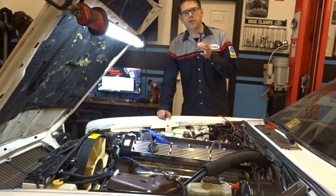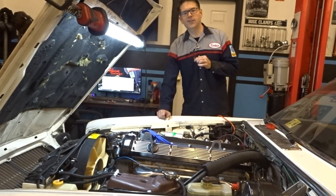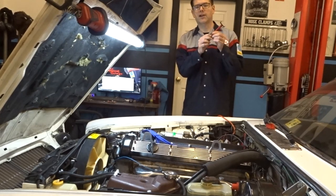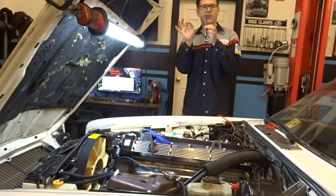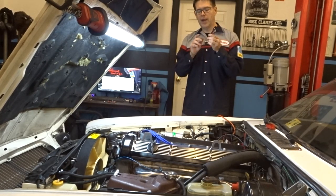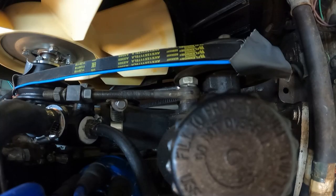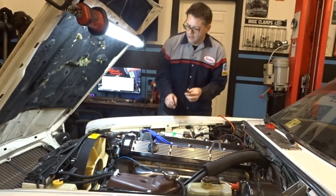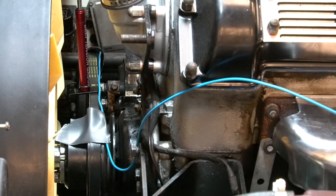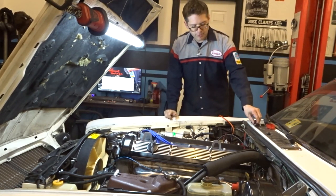Next up we're going to do the belt to the power steering pump. According to the JAG specs, 6.4 pounds of pressure should deflect the belt in the center by 0.17 inches — that's a lot closer to the 3/16 mark. We've moved our O-ring to account for that extra 0.02 inches of deflection and reset the force O-ring to zero. We're looking for 6.4 — past the half mark on our 10-pound scale. We've moved our blue wire to line up with the plane, and when we check it right now — yeah, look at all that deflection. This is a good example of one that's going to need some tightening.